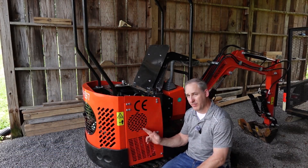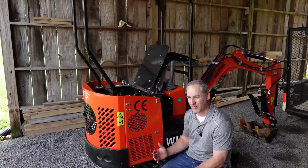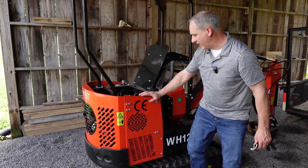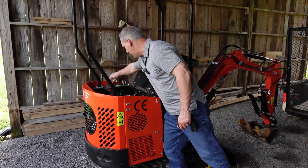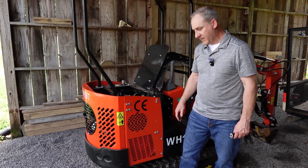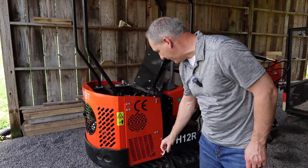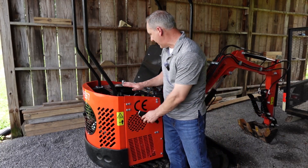The fan is now installed. I've got one bolt at the top, and at the bottom I originally used the zip ties that came with the kit but they didn't hold securely, so I now have three bolts total — easy to put on and easy to remove. As for wiring: black on black, and the blue to the yellow with the green tracer. It's powered by the accessory. Turning the ignition switch to the on position, you can hear it pulling airflow in. Using a Milwaukee glove as a visual reference, it holds right against the fan — it's pulling ambient air in and directing it across the engine.